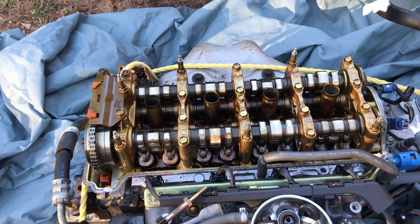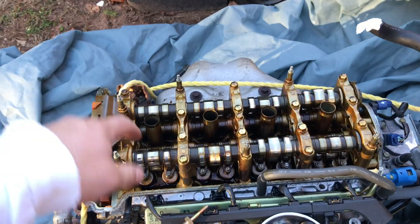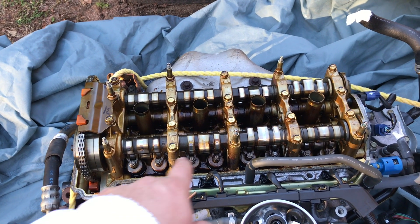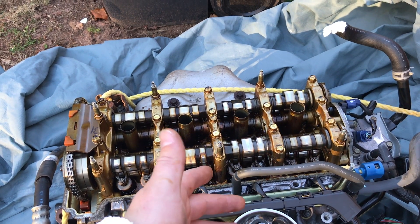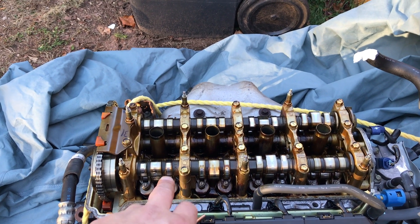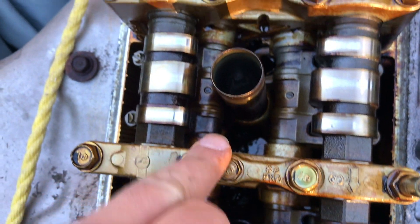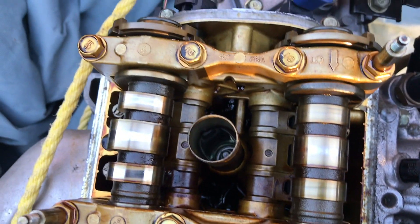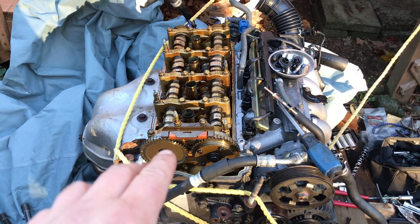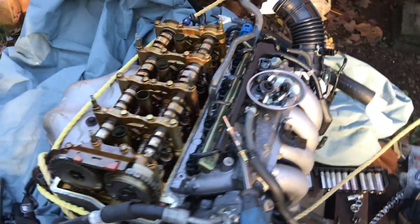Apparently on the Odyssey Absolute and the TSX K24A2s, the exhaust cam is superior but the intake cam is less. I don't know if that has anything to do with the VTC, but I can always do a little hybrid if I wanted to — rip the K20Z3 apart and swap the Z3 camshaft. But I really think all I'm going to do is swap out just the VTC. There's a little bit of sludge on the bottom but the camshafts look good. I pulled out a couple of spark plugs. When the time comes, I want to pull the chain off, the tensioner, and that's pretty much it.